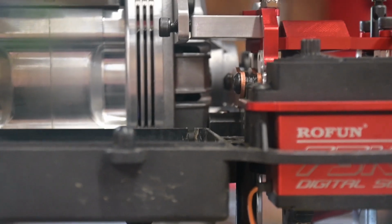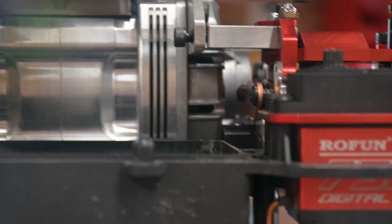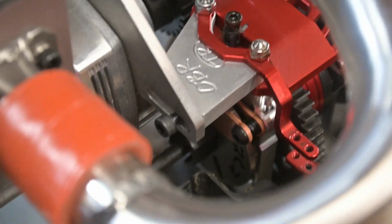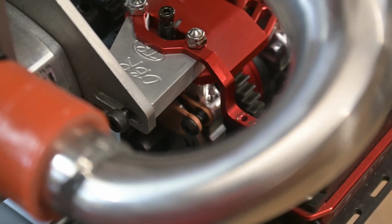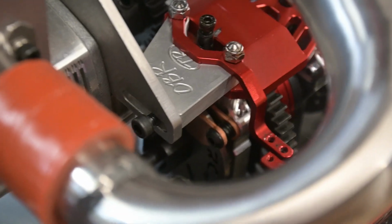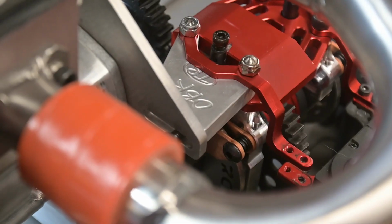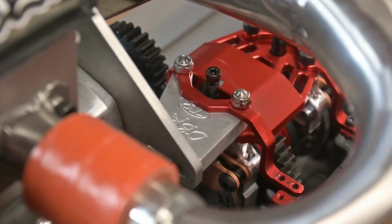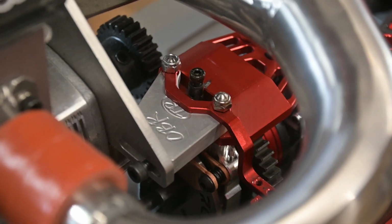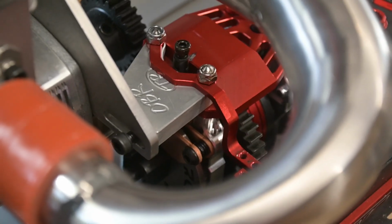That's one of those your mileage may vary type things. It may just be the way this chassis plate is on the Rovan. Places off a little bit more. And then the other issue I have on there, and this is kind of specific to this application only, since I got that Fast Lane split differential, it requires real long bolts to begin with. And once you put the Rovan brace and the OBR engine brace in there, it stacks up pretty high. So I think I got like 62 millimeter length of threaded rod in there with nylon lock nuts on the top there. And eventually I'm going to replace it with longer Allen heads, but that's all I have right now. But that's only relevant if you have this Fast Lane. If you got a stock or some other non-two-piece center differential, the bolts won't be that much of an issue.